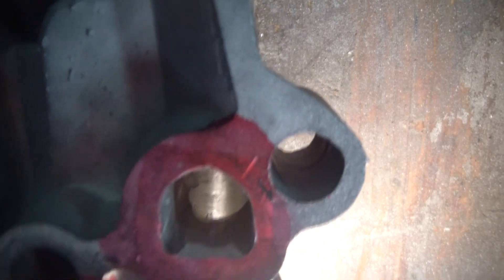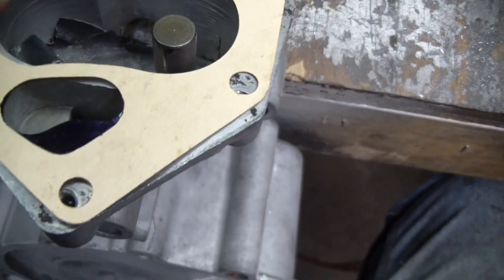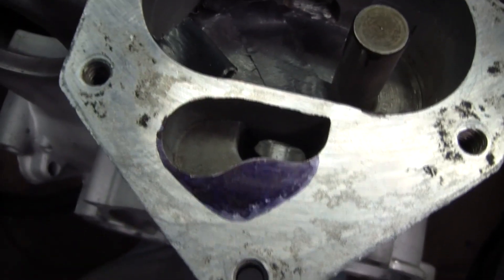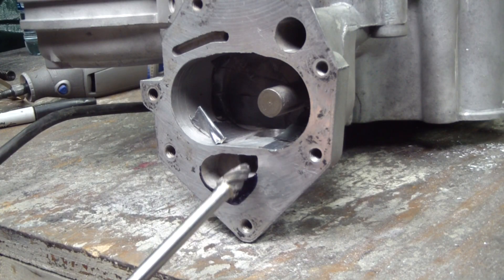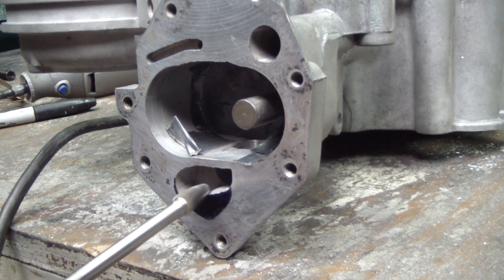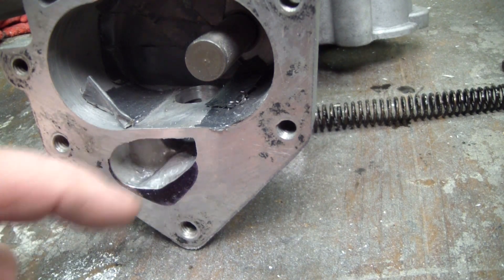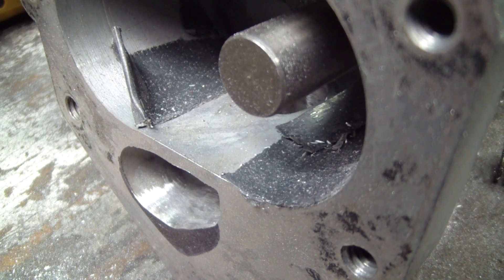Here's the oil pump gasket on the timing chain cover. I went ahead and filled the whole area in there with a Sharpie — that's actually a huge area. If you lay the gasket on the oil filter housing you can see that whole area is already opened up. I'm not going to take all that black there but I'm going to lay it back a little bit. This cover is a little thin right in this area here, so I'm going to stay away from there and just work in the middle a little bit. I wanted the oil to be hitting that filter housing at a straight angle, and I'll just finish it with a 320.